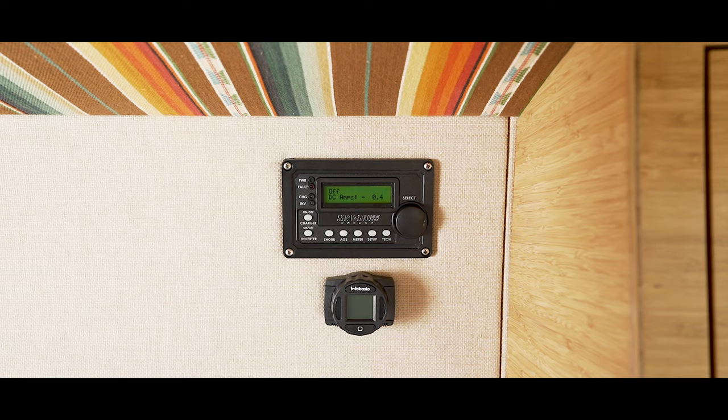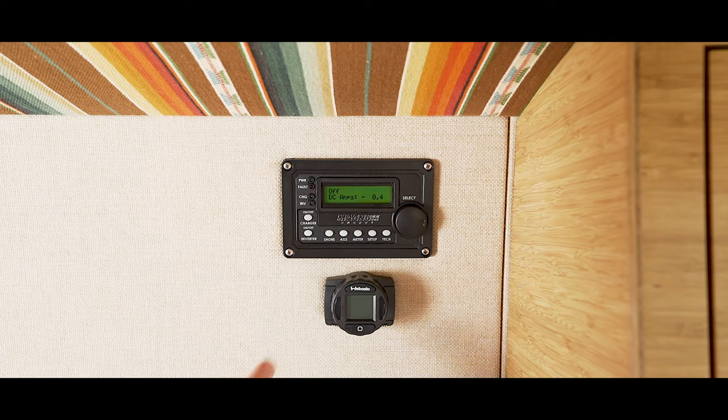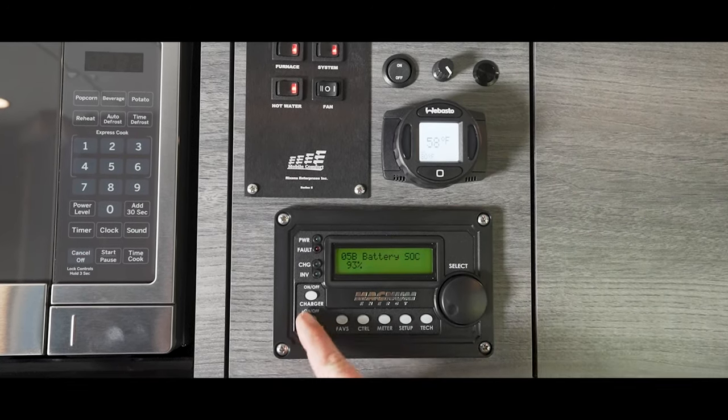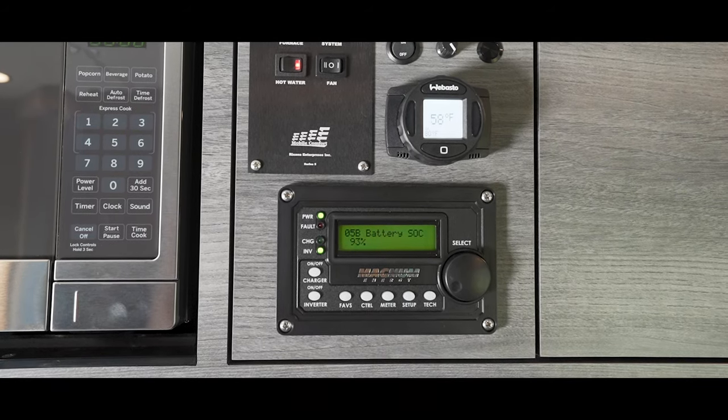As you can see right now the overall electrical system is losing 0.4 amps. That's because even though you're not running any systems in your van like your fridge or lights, your systems like your heater control panel and the inverter control panel have diagnostic programs that are functioning in the background at all times. Because of this you can expect to lose about two percent of your battery per day.